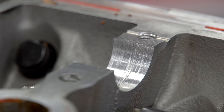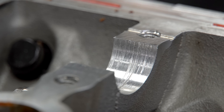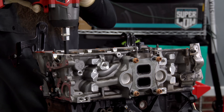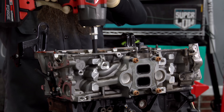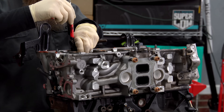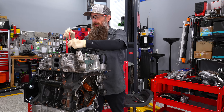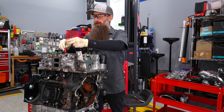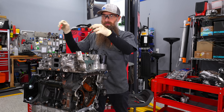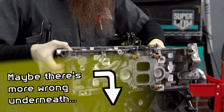Let me get the cam set out, and then we'll take the cylinder head off to do a full inspection on the bottom end. TSI — what does TSI stand for? Totally sucks engineering, but you gotta spell engineering with an I. If you ever take a cylinder head off on a Volkswagen, the bolts are always one-time use — like half the dang car. But save these; they make good punches for various jobs because they're pretty strong bolts.